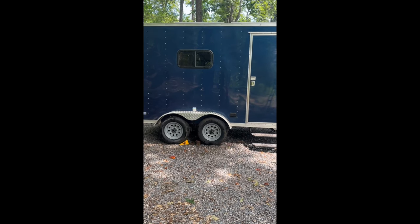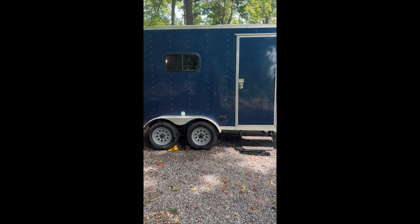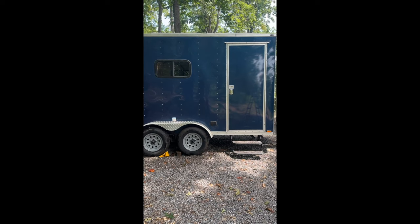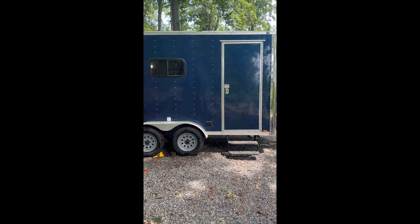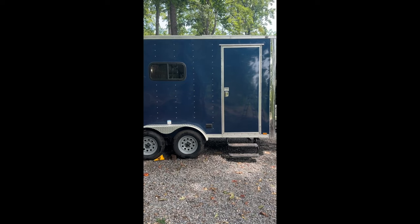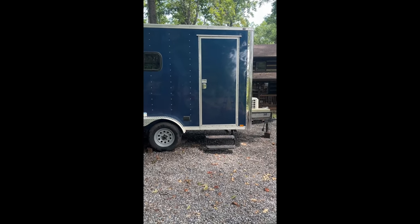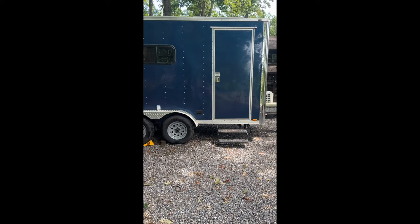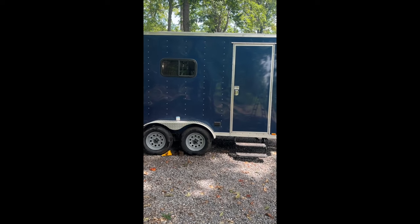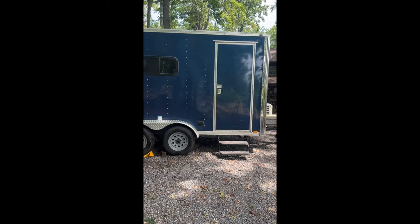The other crucial piece was having a straight axle versus a standard drop axle, where we needed a little bit more ground clearance beneath the camper. I knew I may have plumbing, wiring, and most certainly a gray water tank under there, so having that extra ground clearance was really helpful. The only thing I will say is it does raise the tongue and hitch a little higher, so you might have to adjust the hitch you're towing with to avoid the trailer squatting down at an angle.